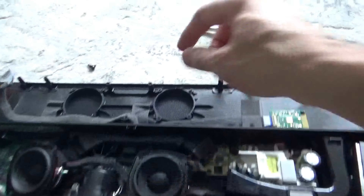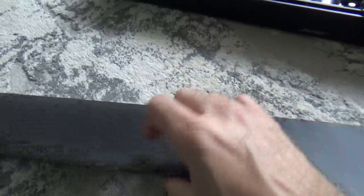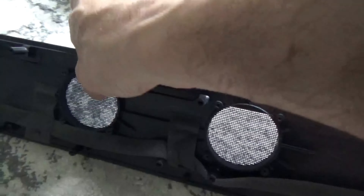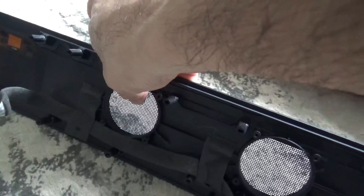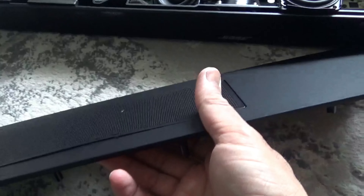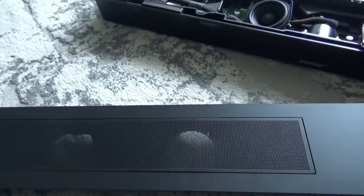They've pointed the speakers that were in front upwards, and obviously there's a software change as well. I've disconnected this so that's come off. To remove this grill, the only way to do it is to push it out — push it gently from here and keep pressing from the bottom, and press here as well very gently. A heat gun would also help, but if we're persistent and gentle it'll come off.